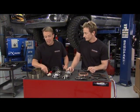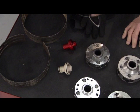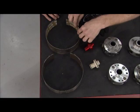It's steel, so it's going to hold up and not warp like that. The accumulator piston is another good example — the stock one is plastic, and these things melt all the time. They're constantly knocking the melted plastic out. This one is a piece of billet aluminum, so it's more temperature-resistant and has two ring seals on the top and the bottom. And you look at the band: you've got a paper design versus a Kevlar lining.